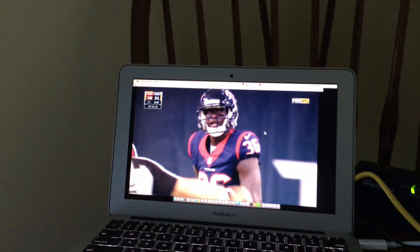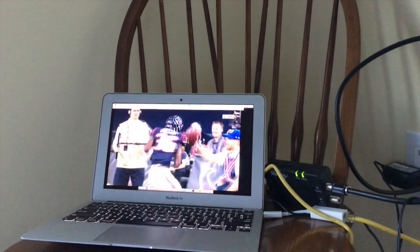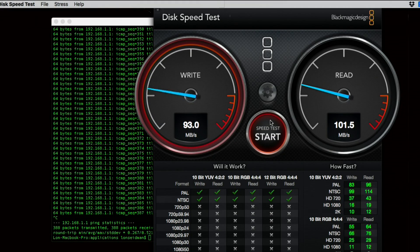I am quite pleased with the performance I'm getting out of these things. For real-world testing, I also loaded up my HD HomeRun app — they are an occasional sponsor on the channel, and I use their devices to bring TV signals into my computer network. One of the best ways to test reliability is whether the HD HomeRun works at all, because it pushes a lot of packets over the network and fails very quickly if you're not getting a reliable connection. In this instance it was working perfectly and has been working perfectly all weekend — no packet loss, even across the house. I also did some tests with my NAS drive and we're getting the kinds of speeds I usually see over my Ethernet, about 100 megabytes per second in data transfers. Really no issues whatsoever.